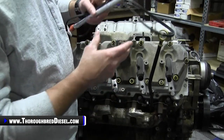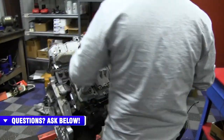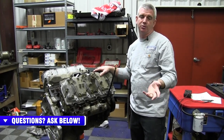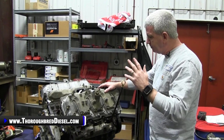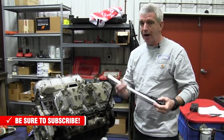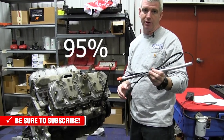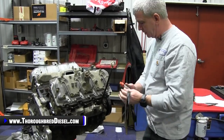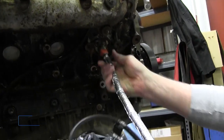Let's talk a little bit about failure and why it's important to note these things. On the Duramaxes, all models come standard with the coolant heater cord. On Dodges from 2003 and up, some trucks had the cord and some didn't — the element was there but not the cord, as some dealers didn't order it. Powerstrokes all have the cord. The cord is usually what goes bad. From my experience with tractors and class-eight equipment, if the block heater quits working, 95% of the time it's going to be the cord — they just wear out, lose continuity, and then you don't have a working block heater.